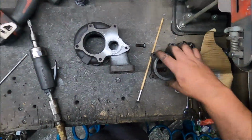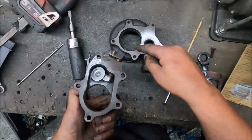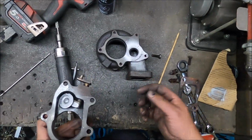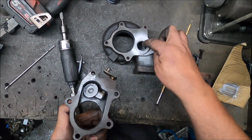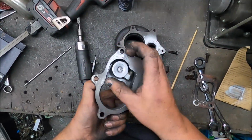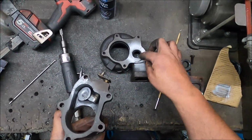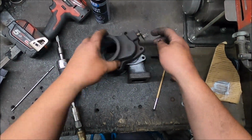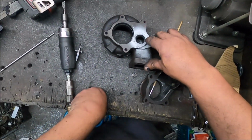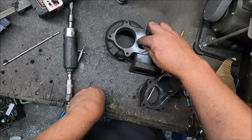What I'm doing now is, although I've not finished outlet, I've got bored of that, so I'm going to go back to it in a minute, is porting the wastegate hole as big as I can. And what I've been doing to try and work out, because the thing is, this wastegate hole isn't centered on this, far from it in fact. It's all kind of this way. So I've actually sprayed some paint and then refitted it so I could work out the real outline of where the gate is. And although it's pretty much on the edge of the standard wastegate hole there is shitloads here.